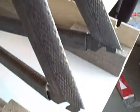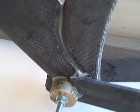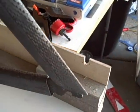Here's the bike. Basically what I did was took some 5-minute epoxy, and I did what you'd do with a spot welder — just to get everything lined up and hold in place: my dropouts, bottom bracket shell, head tube, top tube, down tube. I've taken the front fork and put the headset on just to get everything lined up, and so far it's lined up really pretty well, so I'm pretty happy with it.